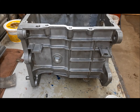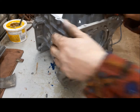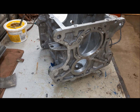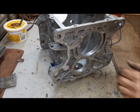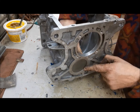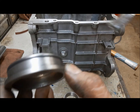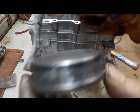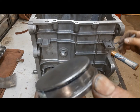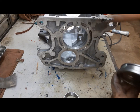First step is to install the countershaft. The front countershaft bearing goes in this cup and gets pushed into the front of the case and it's sealed with this O-ring. Because I machined the face of this, I just want to pop this in and make sure it doesn't stick out. So I'll get this thing greased up, the O-ring seal, and we'll pop it into its bore.